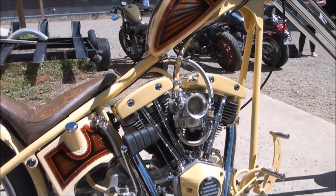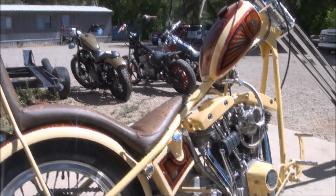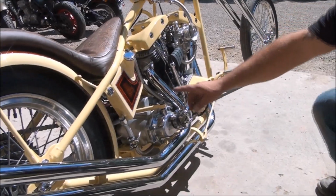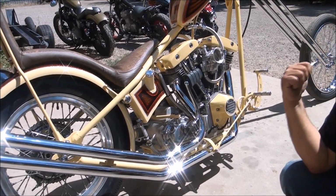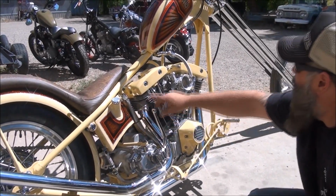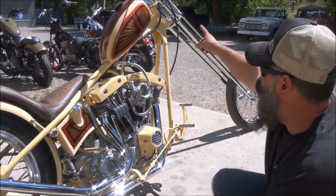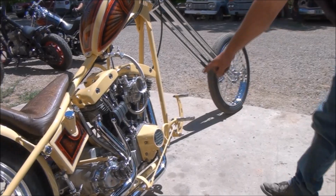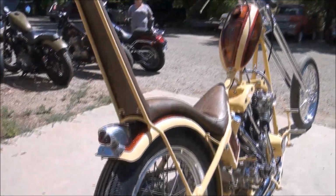We pulled the rocker boxes and the cam cover off and had it powder coated to match the frame. This one, we made everything. We touched every single thing on this bike. We modified the oil tank. Master Vandal Customs right here crushed it. Scooped the oil tank. We took a Wassel tank, same as that one, but stretched it 3 inches to fit the backbone better. And then I made all the forward controls out of all the round bar, all the linkage, all the motor mount stuff, fender mount, sissy bar. Mike made all the exhaust, crushed it on the exhaust again.